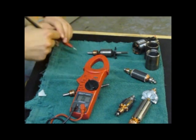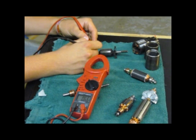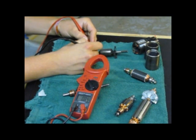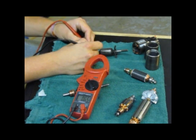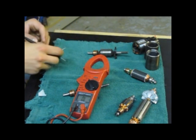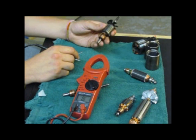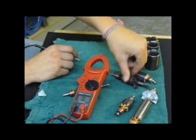Just a little note on variations in armatures: each armature brand tests a little differently. Oster armatures read at about 8 ohms or so, and you still want to apply the 10% principle to those. Basically what you're looking for is consistency and making sure there are no shorts in your armatures.